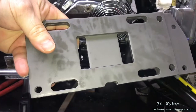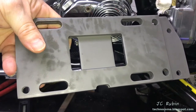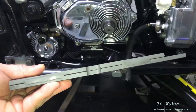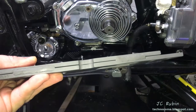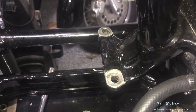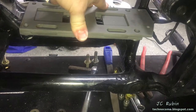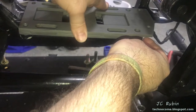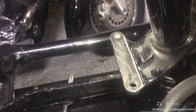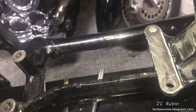I found out they had replaced this plate with a much more stout plate and I ordered one. I'm going to have to rip out the transmission and replace this. I want to show the difference between the two plates - the more modern one is essentially two welded pieces of metal together without those little spacers. I'm going to swap it out. This whole front frame section is going to have to come down to bare metal to accommodate the new mount. I figured out ten thousandths of an inch of shim will stop the remaining wiggle - everything's now balanced. The mounts look a little worn so the transmission will likely need to be shimmed slightly.